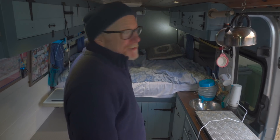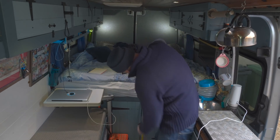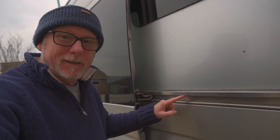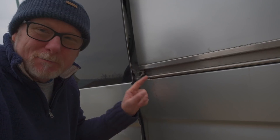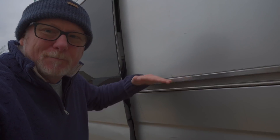I have added a little bit more insulation than I originally had because it was a little chilly, and when I put the windows in I added some extra material which took away about an inch — it was exactly six foot when I first did it. Now the height of the bed is 31 inches or 79 centimetres, and it's this height for a reason. The door runner bolts are on the inside of the van, and because my bed is just above them, I've got easy access to those bolts. There's some rust under there that I may need to address one day — so that's why my bed is the height that it is.